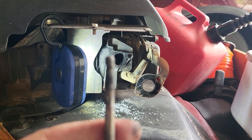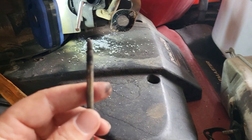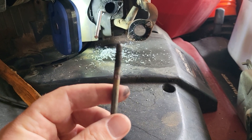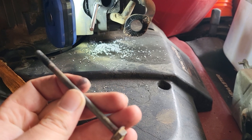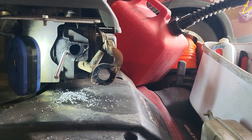This is what the bolt that came out of there looked like. You can kind of tell the threads are galled up on it, and this wasn't doing anything, so I'm now replacing both sides with studs.